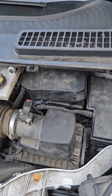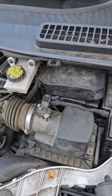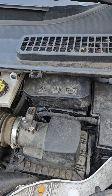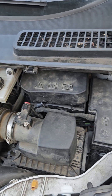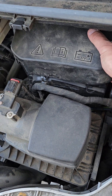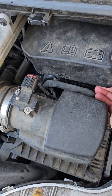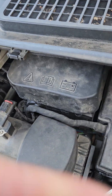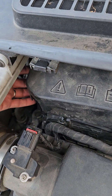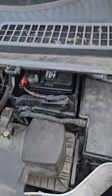If you have a vehicle that had a check engine light on and you replaced the part, if you did a proper diagnostic the check engine light should clear itself out. But if it does not go out, or you just don't have the time to wait, you can reset the computer to clear your check engine light. However, this will not clear the stored codes in the computer — to do that you need to take it to a proper technician to have them use a scanner to clear the stored codes.